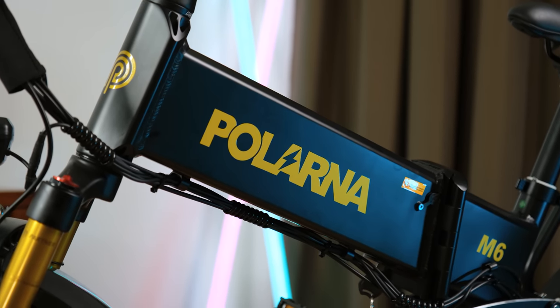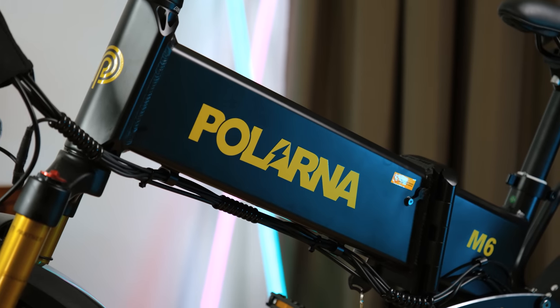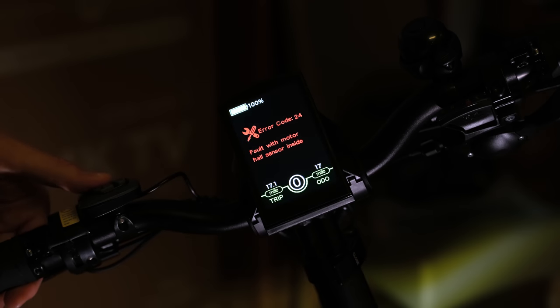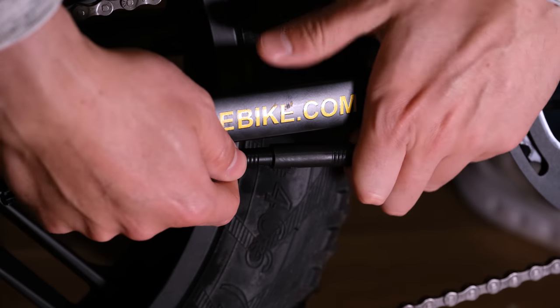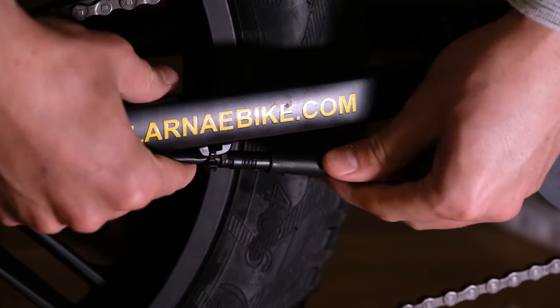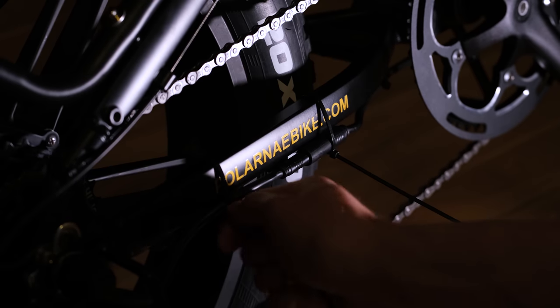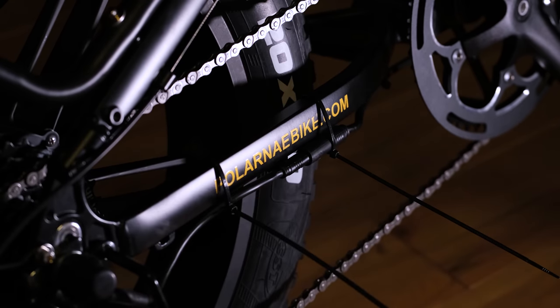So we're ready to go out and give it a try — well, there is one issue that stood in my way. One major hurdle was the constant error 24 motor failure code I was getting on the e-bike. It turns out this was due to how it was manufactured back in the factory. There are zip ties along the frame that hold the motor cable in place; however, it was zip tied too close to the connector and actually damaged the back of it due to the strain. I managed to re-zip tie the connector along the frame in a better position, which alleviated the problem, but I had to be careful not to move around too much as the connector had some damage. So that is something to be aware of.